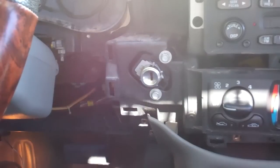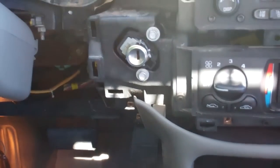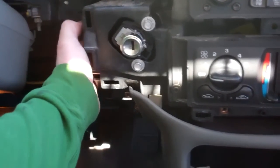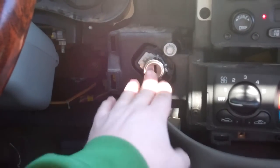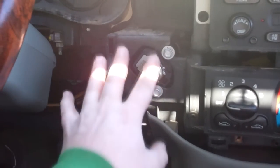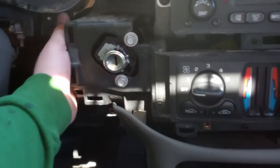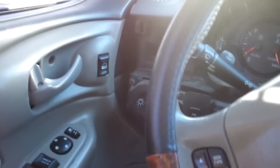Now that we've put the connectors all back in and the park lock cable back in, all it is is shoving the wires back in. It's pretty easy — there's enough room back there. Put your two bolts in right here, and you can put the lock cylinder in at this point too. Just shove it in there, these two bolts go in here, line them up, hold it into place, and that's about it. Then you just put your dash all back together in the reverse of the way it came out.